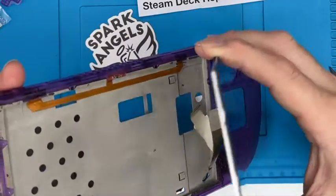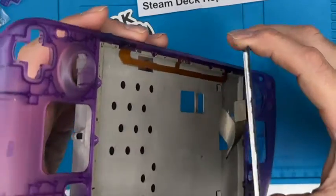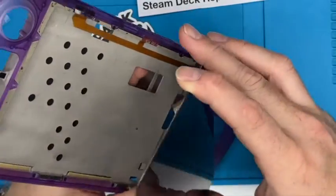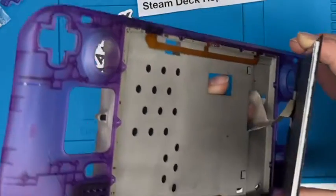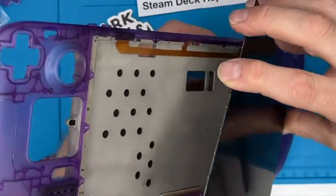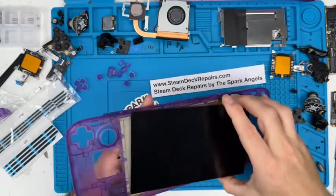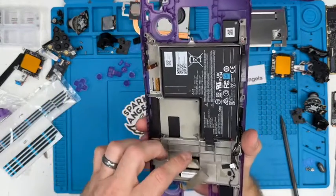Horrible. The first thing we're going to do is feed the cable in, put the screen roughly in place there, and we're going to come the other side and gently encourage the cable to come out of that hole. They are robust, but they're also rather fragile, so it's got to be fiddly gentle. Maybe even, there you go, you just maneuver the screen around. Like so. In a minute I've got a video to do on a dock replacement, and that is just the USB-C dock. Right, sits in place, cable is out.